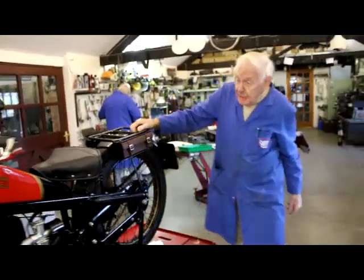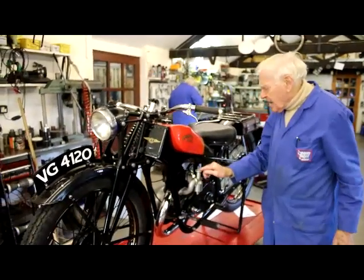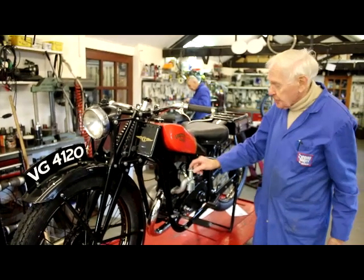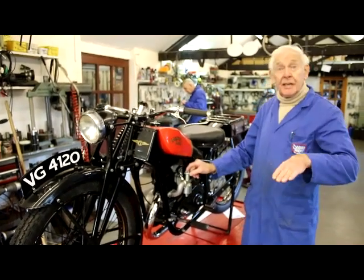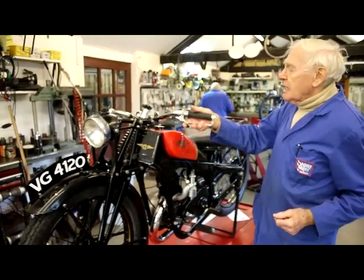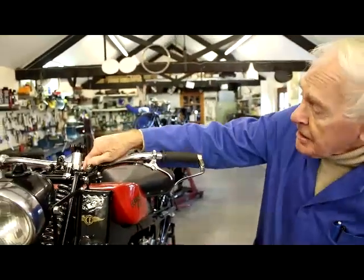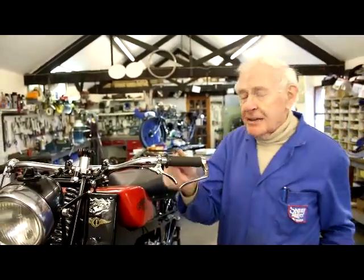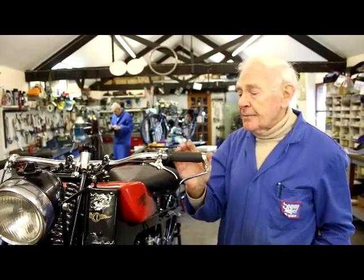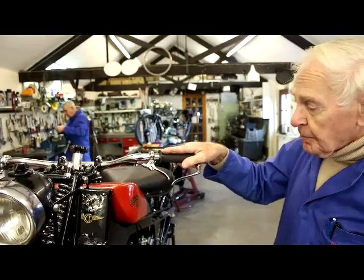198cc Villiers carburetor. Quite a unique Villiers carburetor, way ahead of their time, because you could adjust the mixture control with a little screw on the top of the needle, so you lift and lower the needle literally as you rode along. Inverted levers went out in the early 30s because the cables go down the inside of the handlebars. A nightmare to fit, nightmare to change. So they call it inverted because the cable goes down the inside of the handlebar.